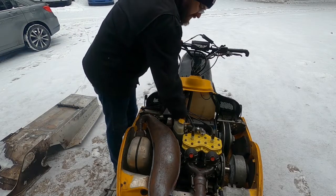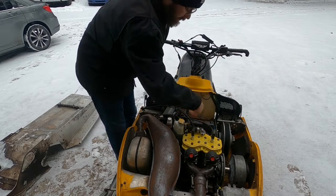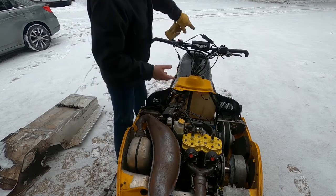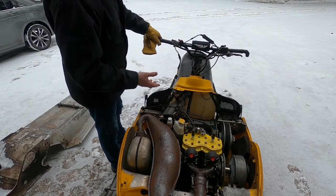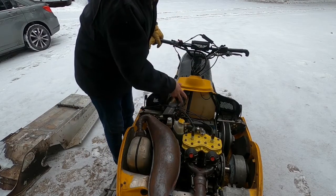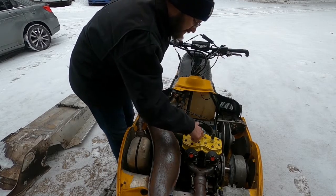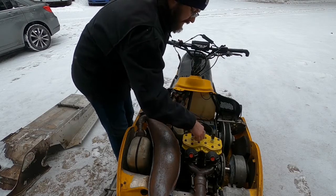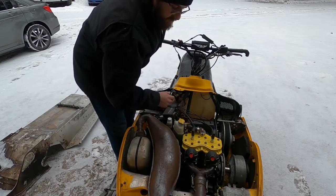All right, so while I was running it I was feeling these hoses down in here. The one that comes out the bottom side of this is actually the thermostat — so once the thermostat opens it allows coolant to flow down through there. Once you start to get a little bit of heat through that, you're starting to actually bleed the system. I was reaching up underneath the tunnel area touching the heat exchanger back there, and it started to get just warm back at that heat exchanger. I can see that the coolant bottle has dropped some — that means there was a little bit of an air pocket somewhere, and as it ran it cycled the coolant through and got rid of that. I also noticed I'm leaking coolant around just this one head bolt, so I'll have to pull that one head bolt back out and see what's going on. They're supposed to seal down against the head — I probably have a little bit too much paint or something and it's just not real happy. So I'll have to take a look at that as well.